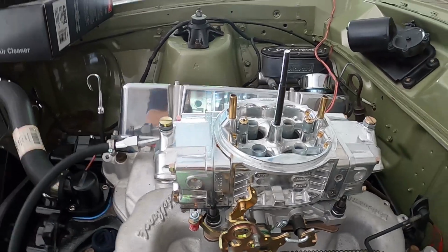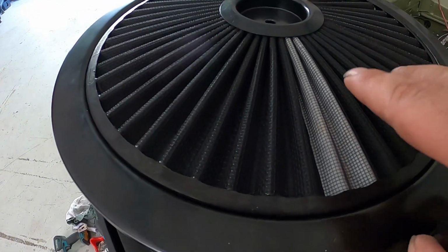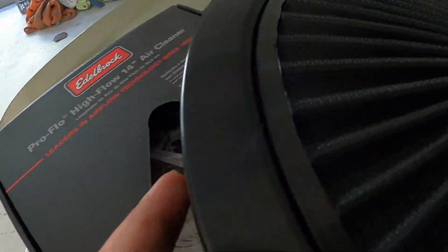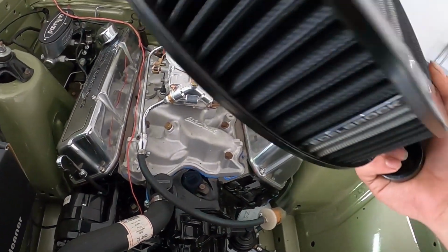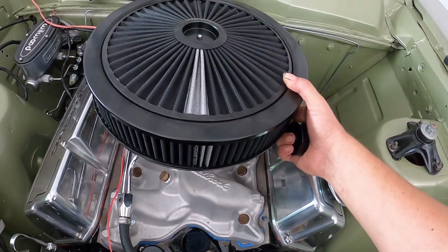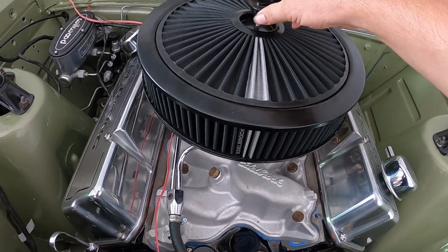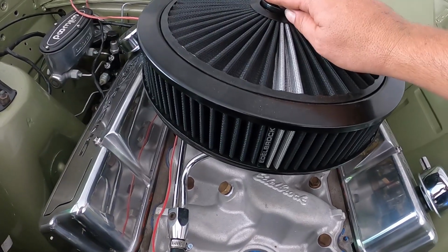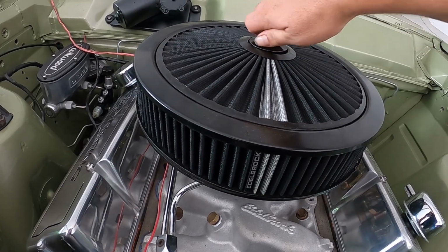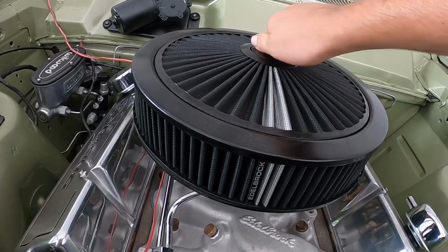And we've got our air filter over here, guys, Edelbrock high flow with the extreme lid. So we may as well grab this now. Check out where it is on the bottom, line it up, so we'll put that forward. Beautiful, there we go, guys. Right there, like that. Let's get this stud here. When you're cutting a stud shorter, it pays to put a nut on there and then cut it and wind the nut off so it cuts a nice neat thread.